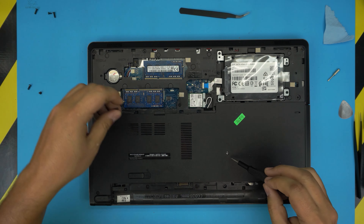Close the laptop back down and slide the DVD drive in from the side. Put the tiny screw by the DVD drive to hold it in place, and the other tiny screw at the edge of the drive. Put the screw on the motherboard. Note: one screw near the hinge is broken so don't worry about that one. Grab the bottom cover, put down the front side and squeeze it down, then put the last two screws on top.